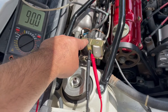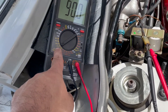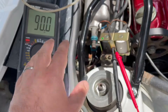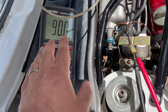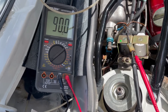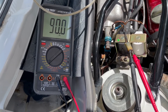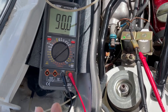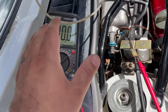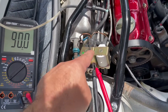To connect the test meter it's fairly simple. These cars have a little test connector just sitting loose in this area. You're going to take your meter, set it to four-cylinder in the dwell setting, and it's reading 90 degrees right now because it's not running. Our target is 45 degrees — the value will bounce, so you want the average to be 45. If it's bouncing between 43 and 47, you're good. On a dwell meter set to four-cylinder, 45 degrees equals a 50% frequency, which is the target for this vehicle.